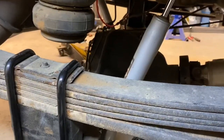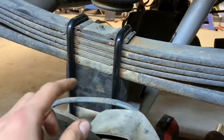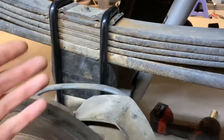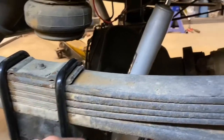Just about have the back all complete — blocks are in. If you saw, I cut the U-bolts. I've done quite a few of these older trucks and there's no point in even trying to fight with the old U-bolts because you're not going to reuse them anyway. So just cut them out, put the new ones in — went actually really smoothly.